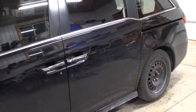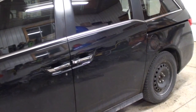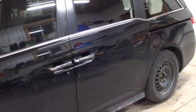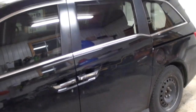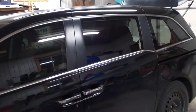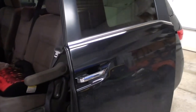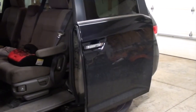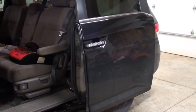Hey Tubes! Today in the shop we got the old family wagon. The left sliding door is not operating as it should — it opens and closes roughly, it's jerky, and we're going to change the center roller. We got the heat maker on today; it's winter time in Canada and it is cold. Let's open the door. When you go to close it, it's jerky and a lot of times it will actually reverse and reopen again because it thinks something is obstructing the door.